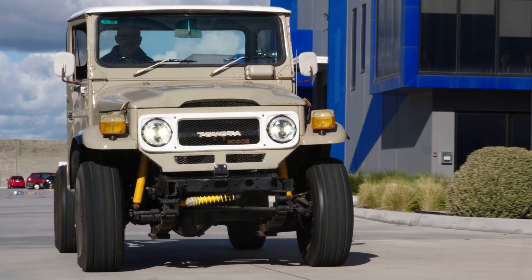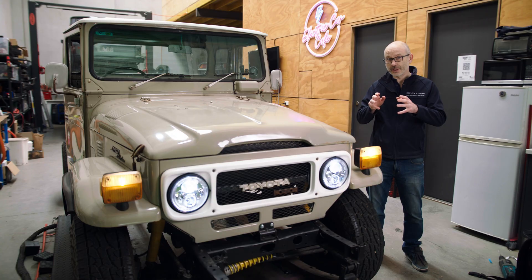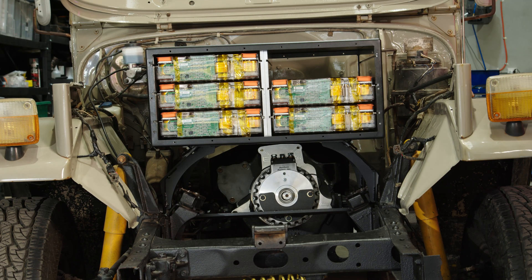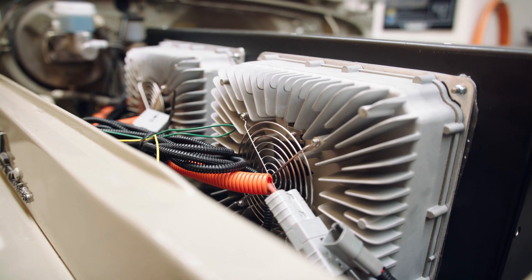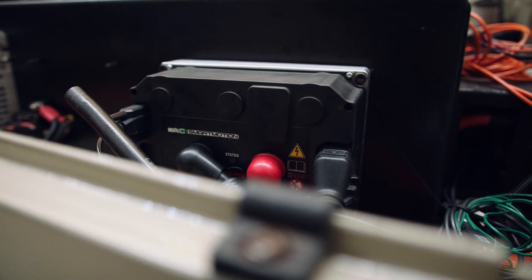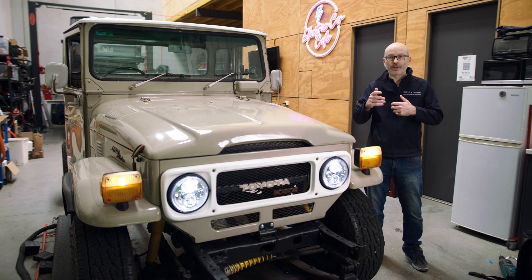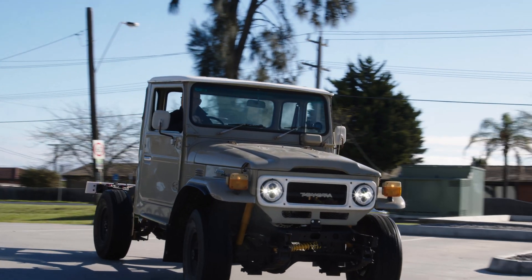The first thing to say is that it's running, but it's not finished. We're in a really good spot. The vehicles have really come on in the last few weeks and we're really happy with the progress, as is the customer obviously. Essentially, the high voltage system is now in and running. The batteries are in and plumbed, we've got water cooling in there, the battery management system monitoring the batteries, and the motor now turning and driving.